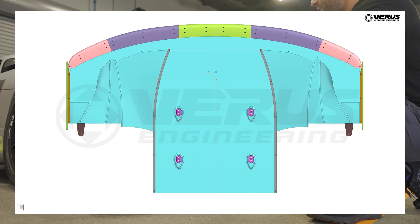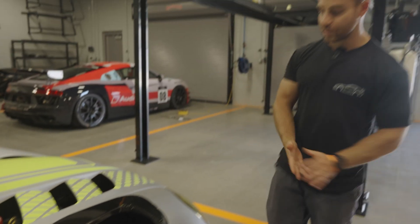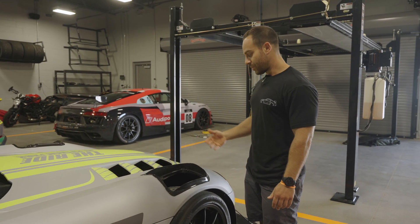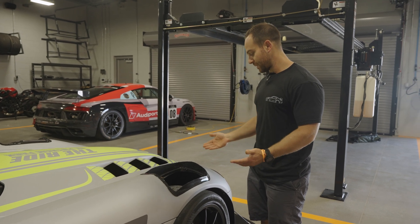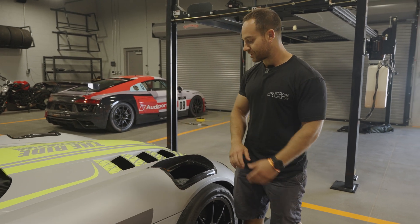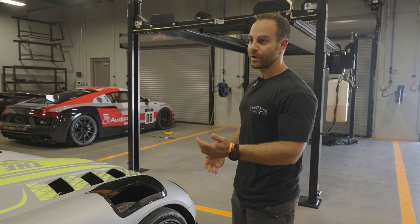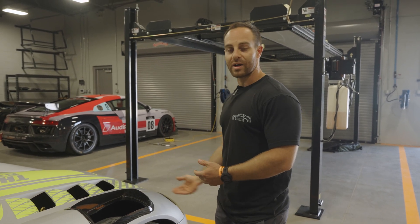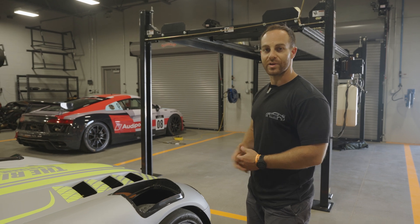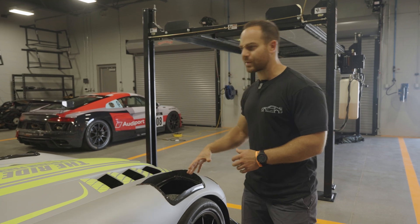On the bottom, we have a large tunnel in the center and we go to factory mounting points on the underside. The fender vents are 2x2 12K carbon, similar to the front splitter. These were transposed onto the factory fender — we used scan data to make it an OEM fit and finish. We also have block-off plates that can block the fender vent in varying fashions to change the front downforce. Chris really wanted the ability to change rear and front downforce levels, so with the front splitter we have diffuser block-offs and fender vent block-offs, allowing a variety of ways to change downforce and drag levels.